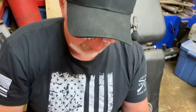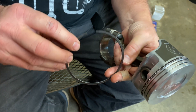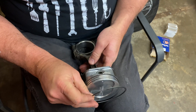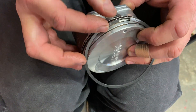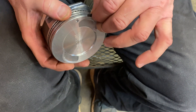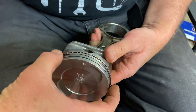Now let's go ahead and install the second compression ring. The second compression ring on this set has a spot on it marked 'top,' because it is a beveled ring on the bottom side — there is a bevel there, and it's designed to be at the bottom. So I'm going to grab the pin side, double check to make sure I've got top facing top, and I'm going to put one corner of it in the second ring gland, just like so. Then I'm going to start rolling this ring right into place. As I get back around, I'm going to pull and tug on it so I don't scratch the piston — and voila, the ring is in place and it moves freely in the gland.